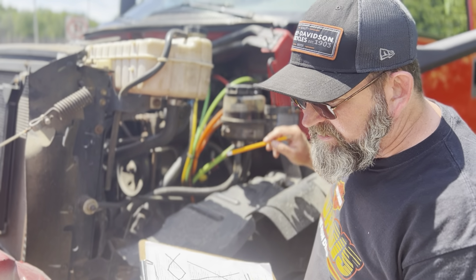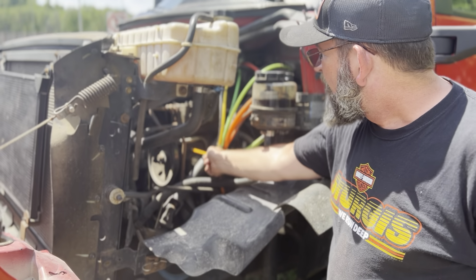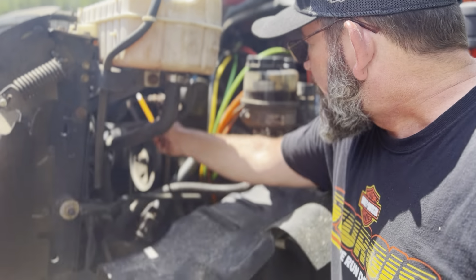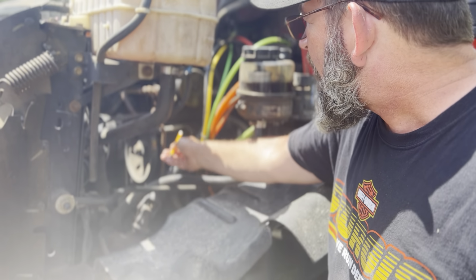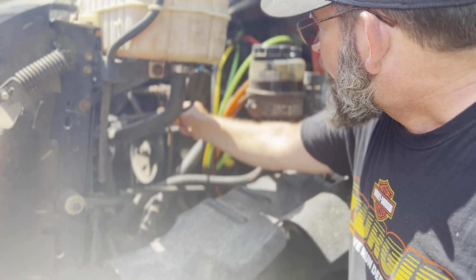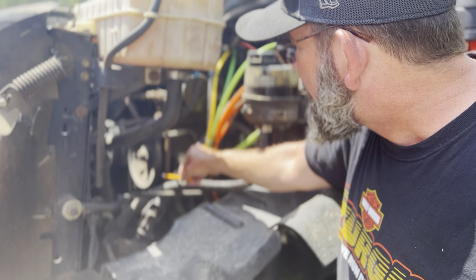Now I'll talk about the air compressor itself. This is the air compressor right here. My air compressor here is not cracked, bent, or dented at all. These lines right here are not cracked, bent, or dented, or leaking at all. I'm gonna look for any liquid leaks and listen for any air leaks up here. Also, there's no missing nuts or bolts or shiny exposed threads.